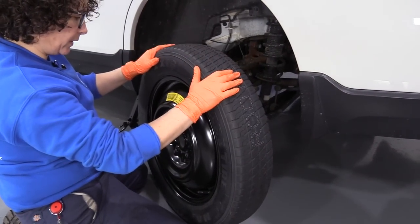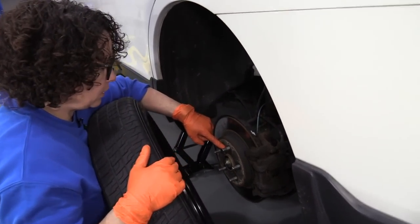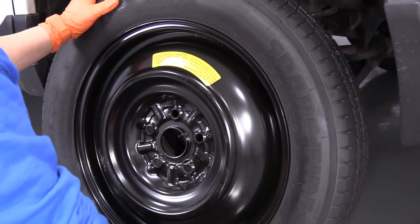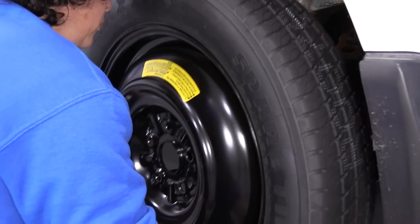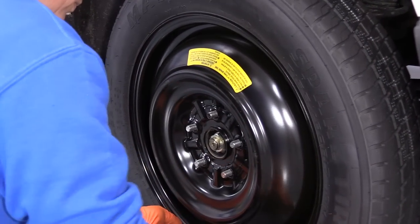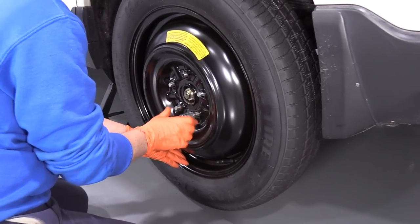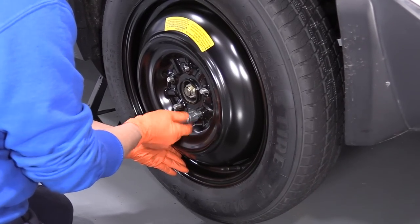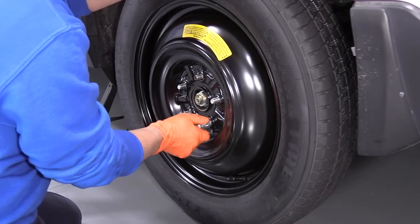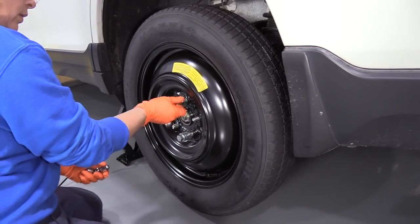Now I'm going to have my spare tire and I'm going to line myself up. You see the lug stud — say it's at 12 o'clock. So I'm going to take the hole in the rim and line it up at 12 o'clock. When I raise it up, I hold it flush against the hub and get my lug nuts. Put one on right away, all the way down, bottom it out. You can push on the top and wobble it back and forth to get a nice seating surface, then put the rest of your lug nuts on.